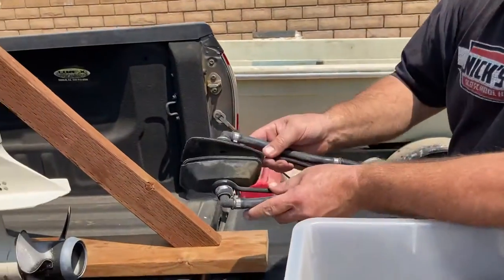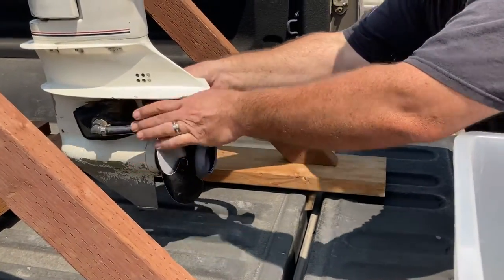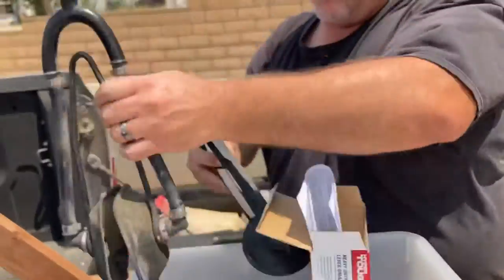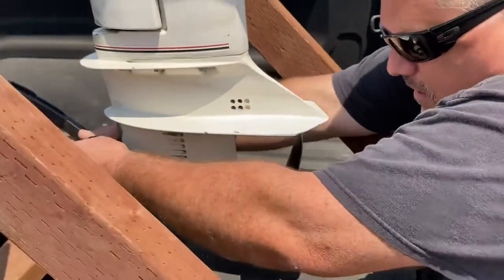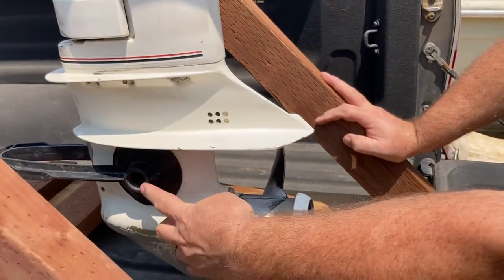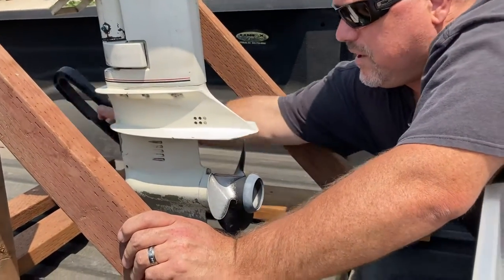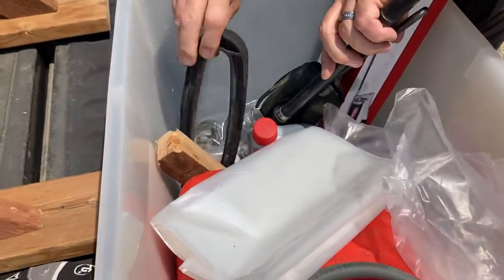Here's your old flusher back. You can go on this way with the prop off, or the other way with the prop on. This one leaks really bad, so I'm going to let you have the old universal one I had sitting around at home. It works really good if you stick it on the back like this and hook your hose up to it. Try to keep the water pressure not all the way up so that it doesn't over-pressurize when you're testing it.